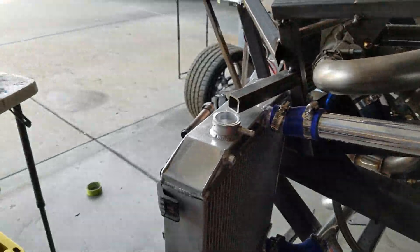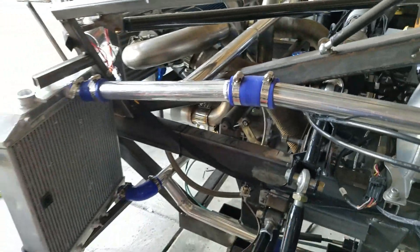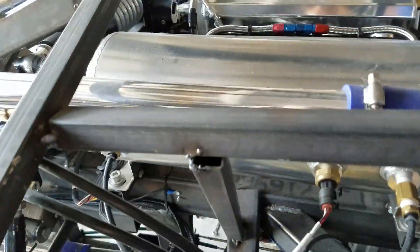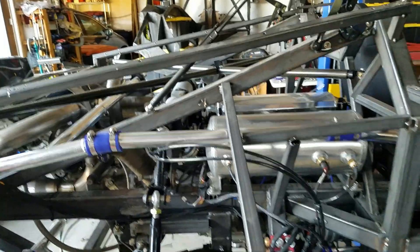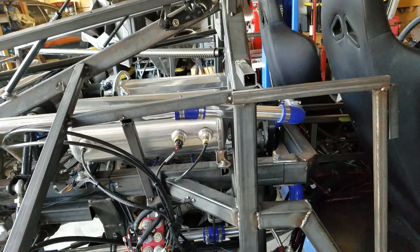The next thing is the coolant system. We haven't gotten the engine up to full temperature yet, so we still need to work on the cooling system. I can see there's a little too much stress on one of these connectors, so I'm going to have to take things apart — which is nice to have all the body panels off to do that. There are probably some bubbles in the system because it's above the radiator, so we have to make sure we get good flow. But so far it hasn't leaked, so that's the good news.